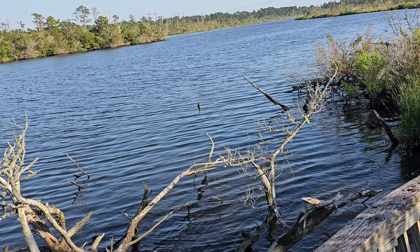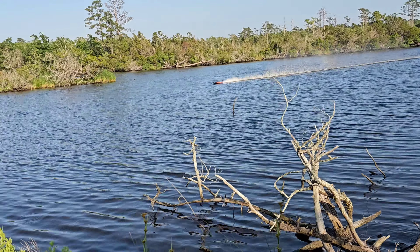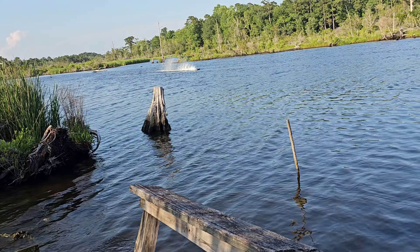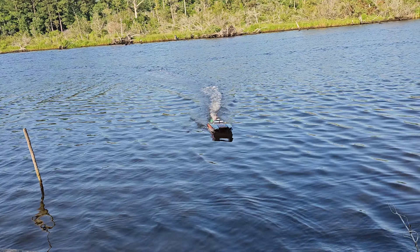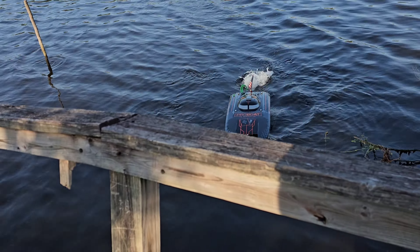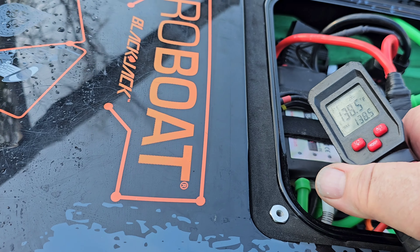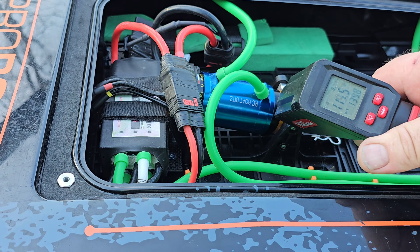We're going to do one more pass. I'm going to bring it in and just look at the wires. I'm pretty sure I got everything tuned in right on the card. I got my timing at five — this is a Y-wind motor. I don't think it's a power cut; it would cut for longer. That's not like a sputter. Temperature readings: 114, 108, 102, 128 back of the motor, 132, 127. Temps are pretty good.